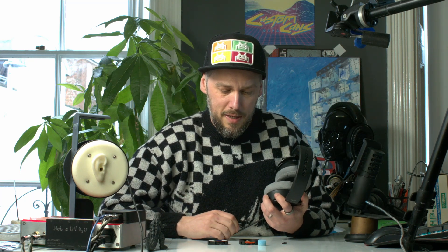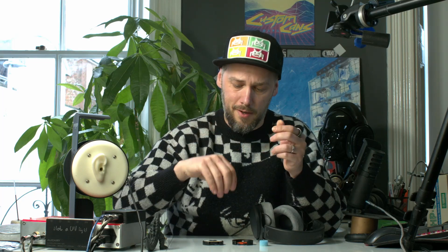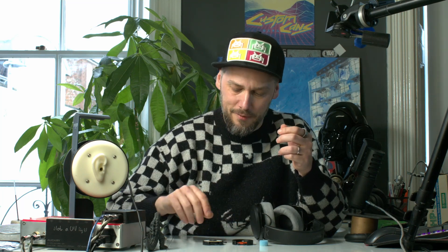If you're using these for producing music you might want to go for the 2mm flat response. I hope that was interesting - it was much harder than I imagined it would be. All of these bits are important. These little doohickeys just reduce the size of the bass port on the side, because after I'd done the other mods the bass level was too high. I put these in to reduce it and I'm very proud of these because they fit really nicely - quite an elegant solution. This little bit that goes in between the stays reduced a dip at about 6k - popping this in behind there stopped that.